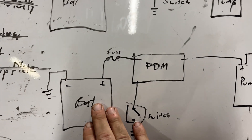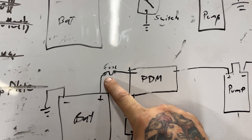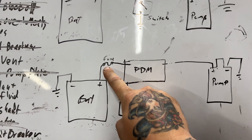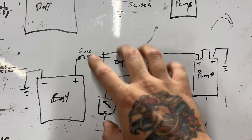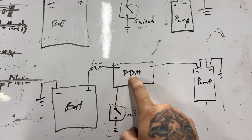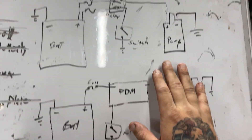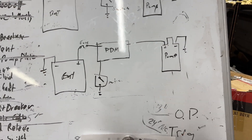So now we're gonna talk about the PDM and why it's a superior thing. So this is a PDM. We have a battery, PDM, a switch, and a pump. There's one big power wire that comes to the PDM — it's got a fuse on it, usually like a main engine fuse, like 100 amps. The PDM gets all this power, and PDMs have to be programmed — it's basically another computer. What you tell the computer is when this output goes to ground, send power to the fuel pump — boom, on. So built into this PDM are fuses and relays for the circuits. It's all built in, so we get rid of the external relays, fuses, and extra wires. It really simplifies a lot of it.